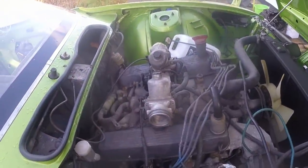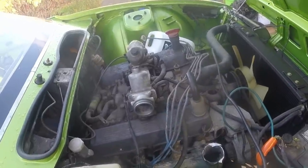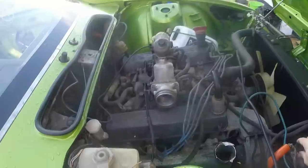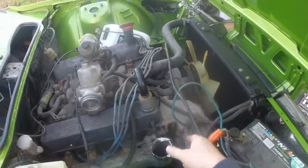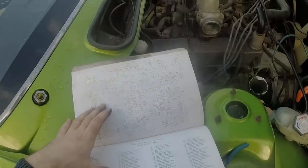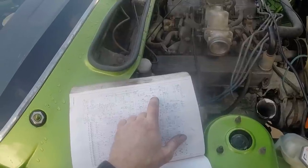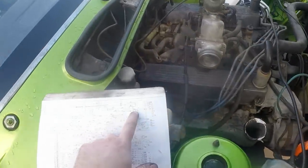Rather annoyingly, I'm not getting oil pressure — the pump isn't switching on and the gauge isn't moving. It's possible this is a wiring issue with something not plugged in right. I'm going to get another battery and jump the pump directly to check it's capable of working. If it is, then the problem is either the switch or genuinely no oil pressure. I've pulled out the wiring diagram — the oil pressure switch and fuel pump run on a white-purple wire, so I'll give power to that with my power probe.